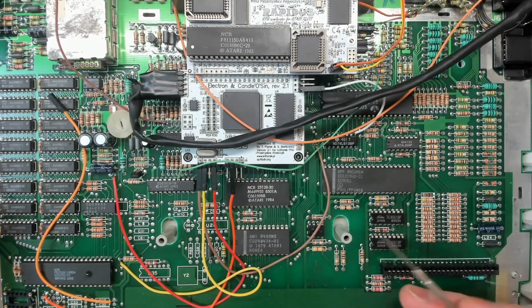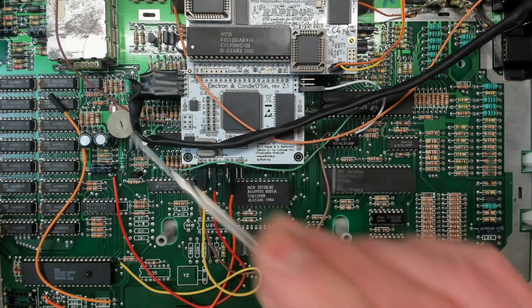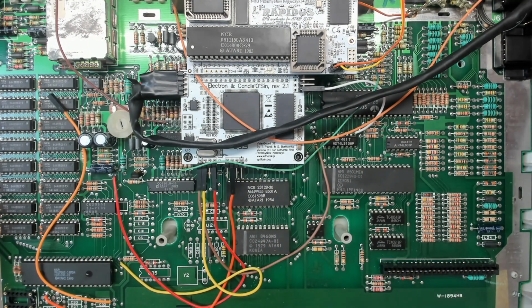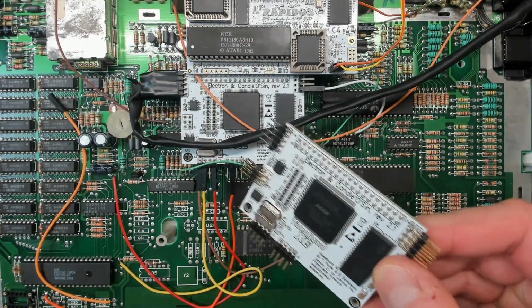Yeah, and VBXE does not need a current limiting resistor on RGB blanking control. Don't try and use it with a stock Apple IIGS video cable, because it's not going to work. But other than that, I think it's more or less there. Just a shame about this VBXE. I'm dying to know. I'm stone dead.